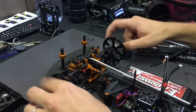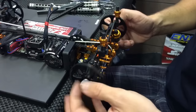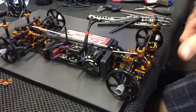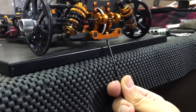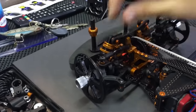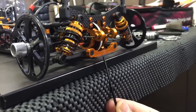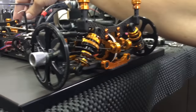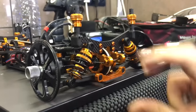By lifting the rear part of the car — the chassis has two points in the rear and also in the front — this is the place where I put a 1.5 gap. I lift the car and check if both wheels go up at the same time. Over here I can see the right side is lifting earlier than the left, so I have to tighten the left front spring and loosen the right spring. Checking if it's okay now. The left one is a little too much, so I need to go back a little. Now it's lifting at the same time.